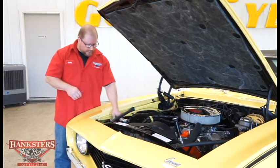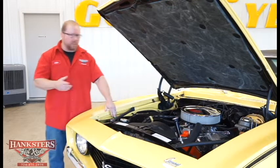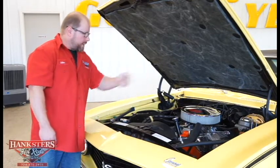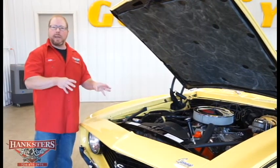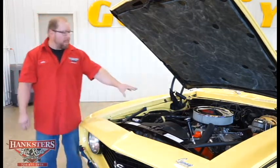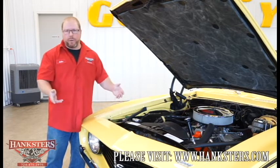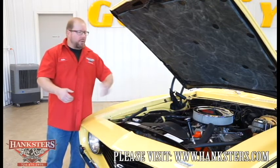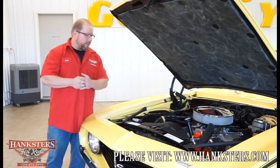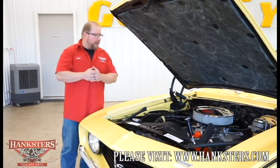The battery is the original-style Delco unit retaining that old-school look, with a battery disconnect installed. The hood braces are painted black and in good shape. To summarize: this is a non-original 350 cubic inch engine, but it is a date-correct 1969 block. The drivetrain consists of that motor mated to a Muncie four-speed transmission and a GM 10-bolt rear end with an 8.2-inch ring gear — pretty good for a stock 350. If you ever upgrade, it becomes a trickle-down effect from one end to the other.